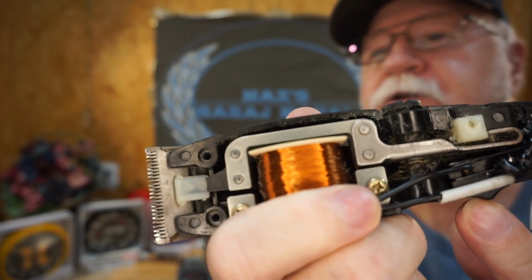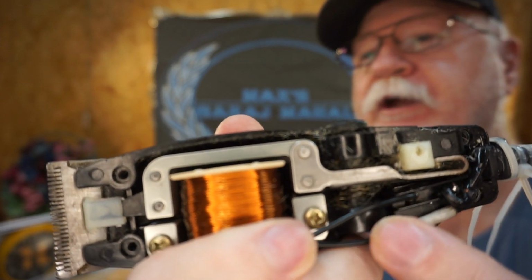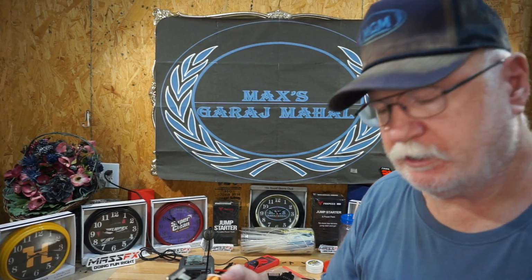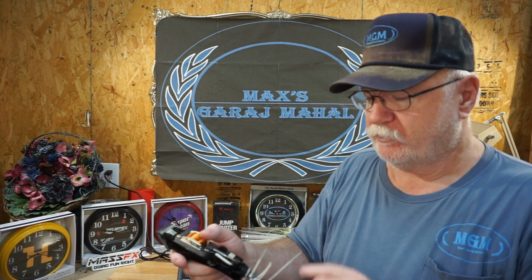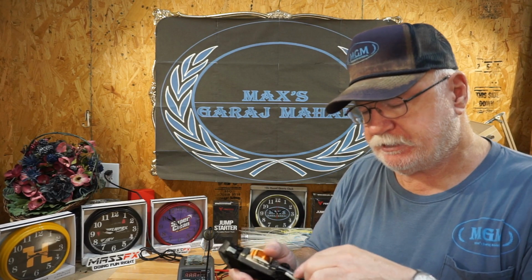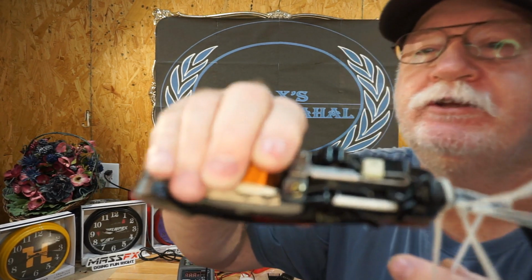Okay, there's your switch, and down there, right there, you can see where the two wires come together. I'm having to do this backwards. You can see where those wires go down inside those two little metal prongs. What I did was, those things were not losing contact, but to make sure and to guarantee they didn't, for as long as this wire here will last, I went ahead and heated up those metal prongs, and I put a drop of silver or solder inside each one of those. And I don't know if I can make that any easier for you to see or not.